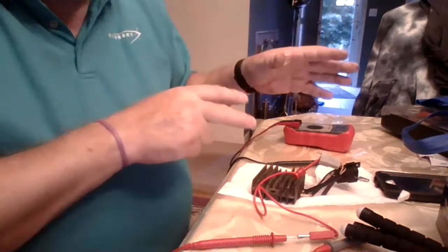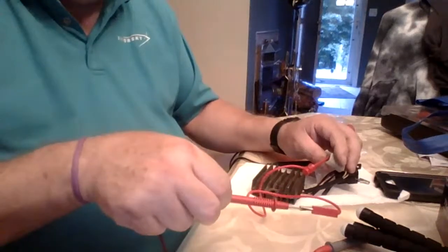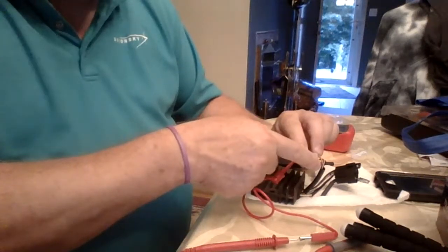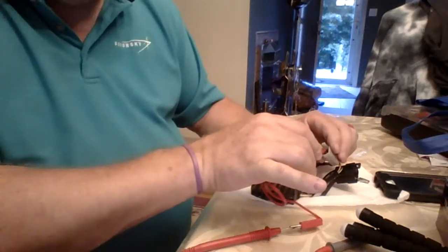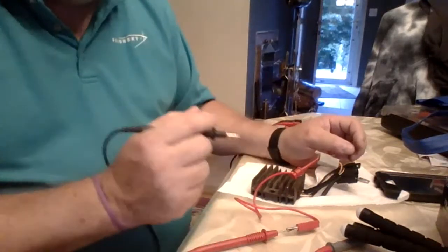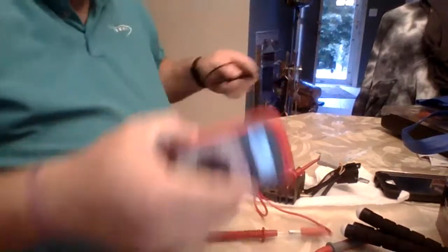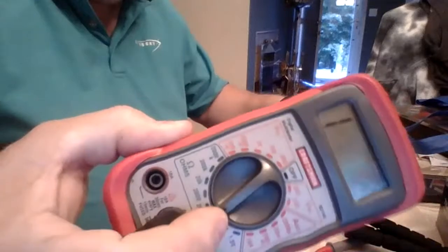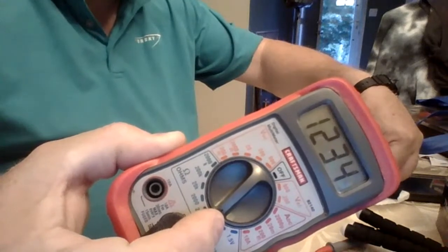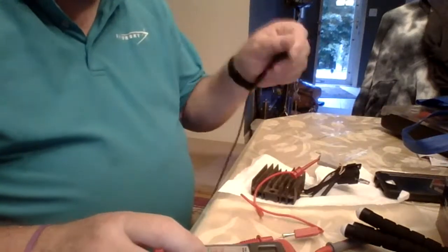What I'm going to do is test to see what readings I get using the diode test on this charred regulator. First thing you do is hook up the positive lead of your tester to the positive DC lead coming out of the rectifier — sometimes red, most of the time orange on this type. That's hooked up. Then you take the negative lead and one by one hook it to each stator line to see what kind of reading you get. The first one is showing 1234.